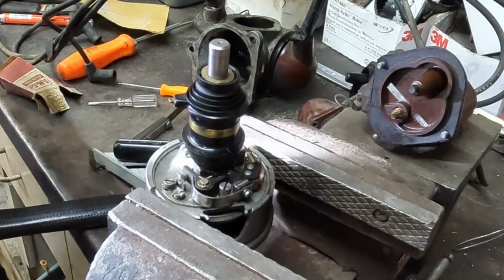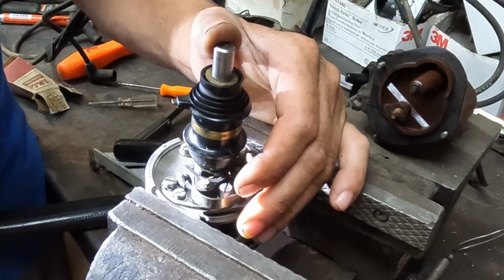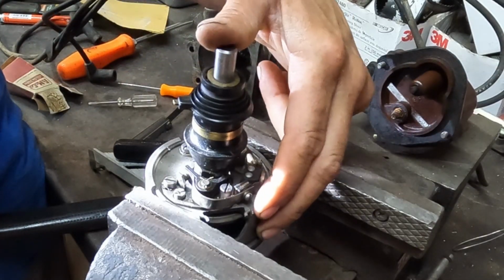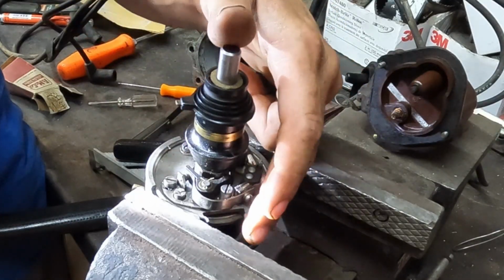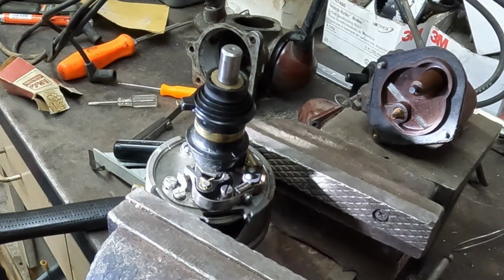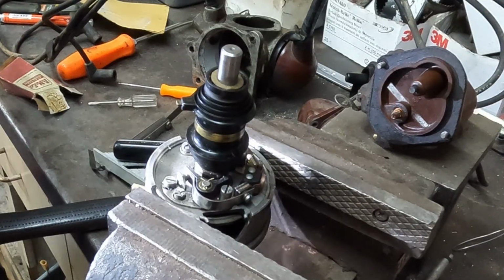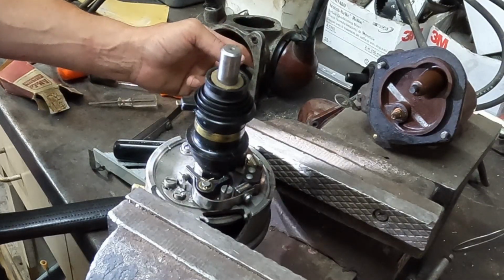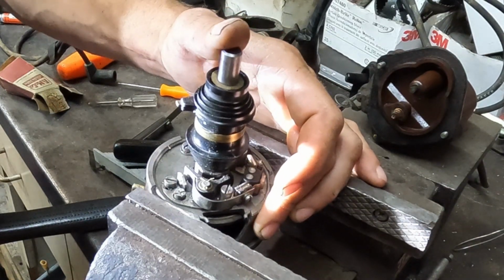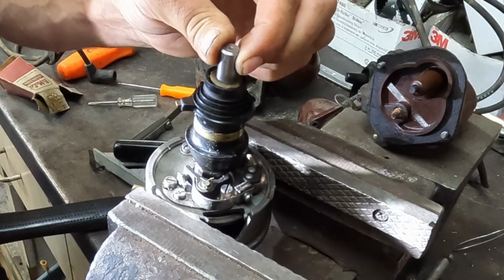Look at that, I just learned. Doing it outside of the distributor is going to change my gap. I have to set these with the distributor in because this is moving and it's changing my gap on my distributor. So that's not fun. I'm going to have to get these caps out because yeah, with the shaft not being in there, it's not necessarily straight. In which case, it's going to alter and change the gap on those points when I put it together.